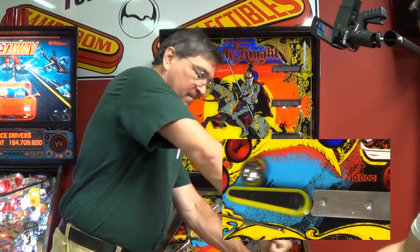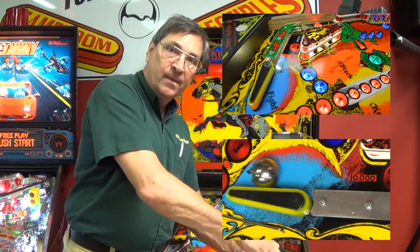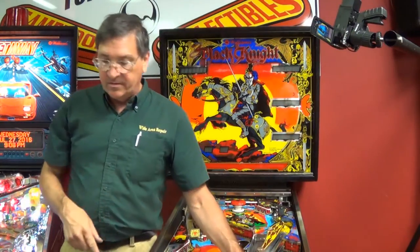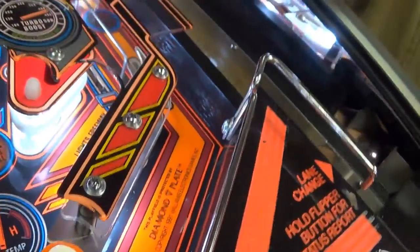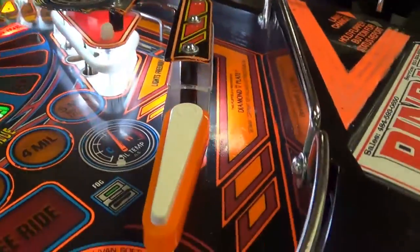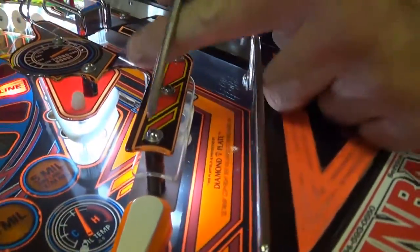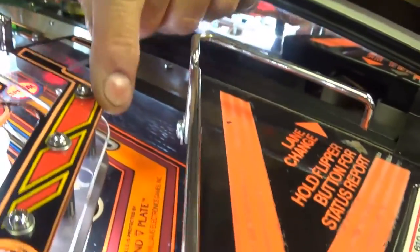Here's what it looks like when it has a plastic on top of it. You want to use washers like you said so you don't kill your plastic - you want washers on both sides of the plastic because you're going to be tightening down tighter and plastics don't like to be tightened on. New ones, unlike this optional one, these new ones do have plastics from stock. Here's an example of where it's got the plastic standoffs. The reason you're cutting the tops off of those is so that you can put your washers in there and have it sit nice and flat.